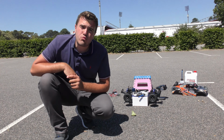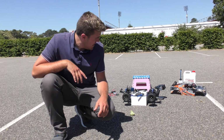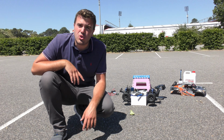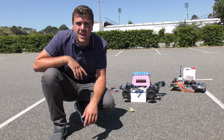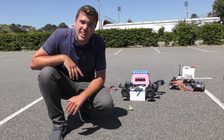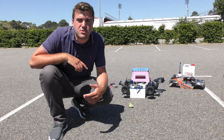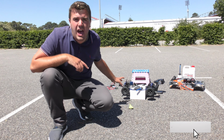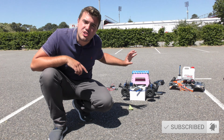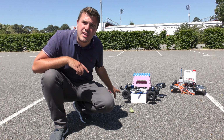Running on a fairly rich setting, which means there's a little bit of extra fuel going in there, and in the next video we will do the full break-in process, so make sure you stay tuned for that one. Started very easily, nicely done, just needed a little bit more throttle trim just to get it going, and you can see now it's been running for a bit. Now I need to turn down that idle, so I'm going to do that now and I'll catch you in the break-in video.